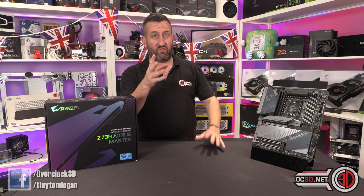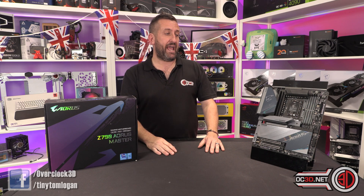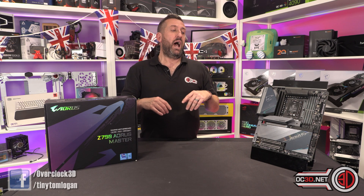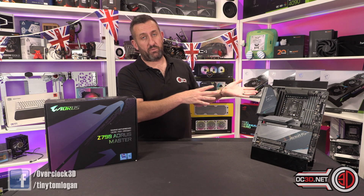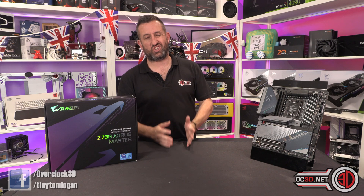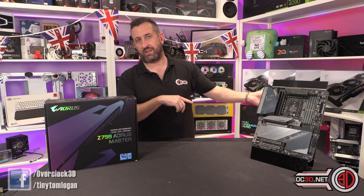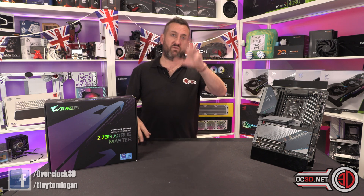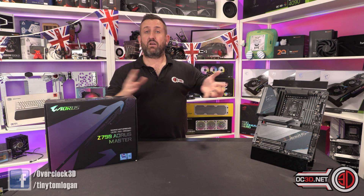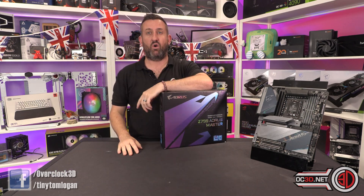So my tips: the extra volts didn't necessarily mean extra heat, and use turbo on the load line calibration — I'm sure you'll get the best out of your processor with this board whether you get the i5, i7, or i9. Don't forget you can check out the other motherboard reviews on the website, including the AX — the AX is a board for i5s or stock i7s and i9s, it's not a big multi-core overclocking board. We've also done DDR4 versus DDR5 guides on the channel. Please like and subscribe, and I'll keep churning out these reviews as quickly as I can.